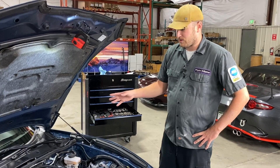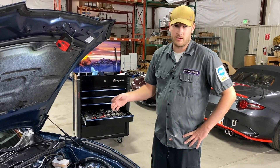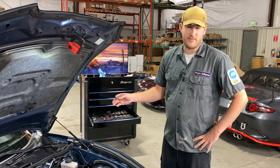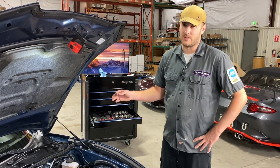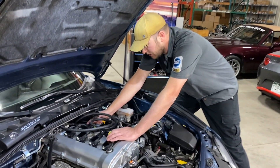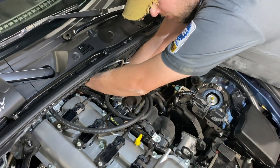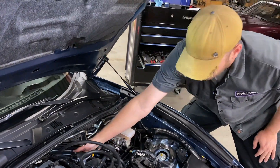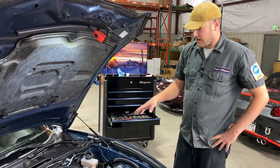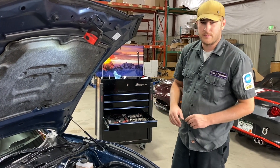Now that we're done, I also want to go over a couple other things that are not a good idea. Getting it from the bottom is not really feasible because the starter is right there. We also do not advise that you take off the intake manifold because there's a lot involved there and it definitely complicates things more than you need. One good idea is to stick one arm in this way, get things lined up, and then reach in from the top to get the hose pushed on. That's the way we did it here, and we are finally done with the hardest part. We can now mount the air oil separator to its bracket, get it in place, hook up our lines, and button up the job.